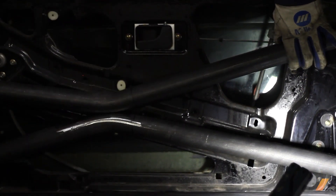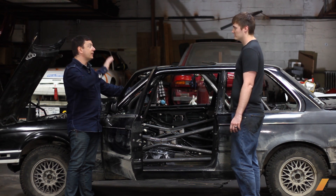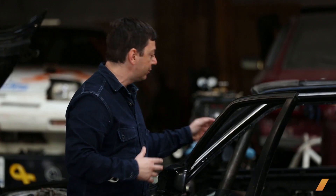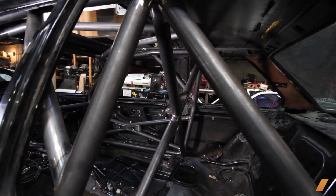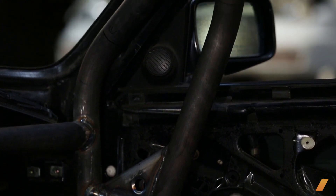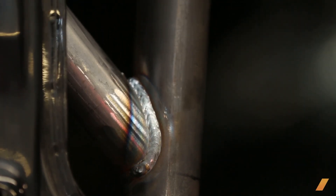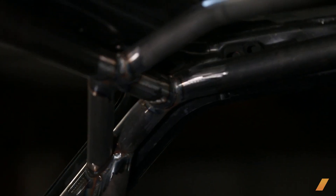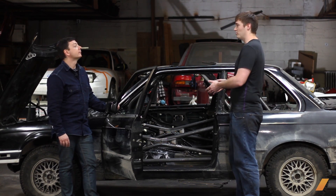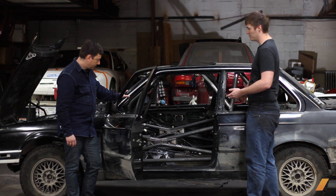The rulebooks for different racing events are obviously different. Because this car is going to be competing in multiple events, we had to standardize some things — use the highest common denominator on some of the rules and make it fit for the others. The size of the tubes is important for Chump Car, while the layout and construction of the cage is important for NASA Rally. So the design is a NASA Rally — really an FIA Rally design — with a few bars added for extra support, and then we upgraded the bars that needed upgrading for Chump Car and road racing, which is essentially just the door bars, the rear down bars, and the bars that make the X in the main hoop.